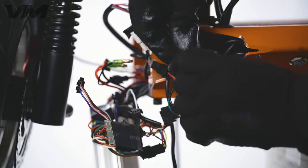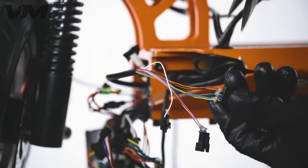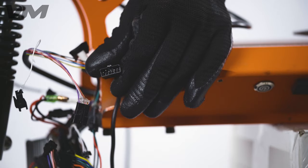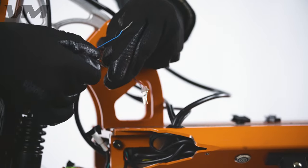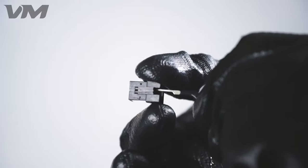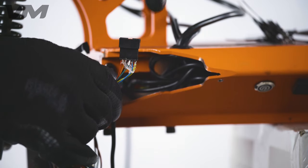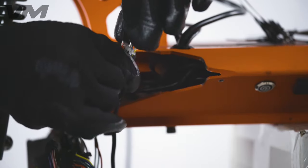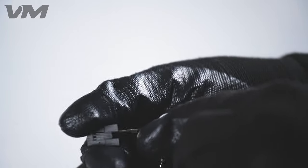Once you find them, you can push in the latches and pull them apart. With pliers, lift the hot glue remnants from the connectors. Taking a sharp, thin piece from your terminal removal kit, fit it into each of the pin slots along each connector and push the pins out. Watch out for your fingers during this step — these are very sharp blades. Here is a unit that's already been cleared. The metal tool goes into the slots you can see the light through; it will be the side closer to the latch. Look at the pin and see how it has a small metal piece sticking up — this is what you are trying to push in the previous step. Once you see the metal of the pins peeking out of the other side of the connector, you are good to pull through. If any of the pins get stuck, try using one of the tools to push it out.